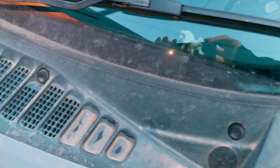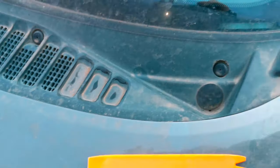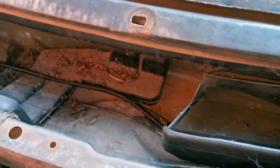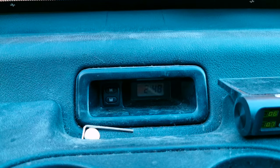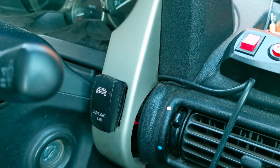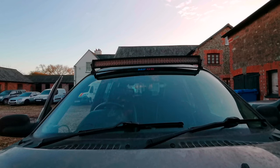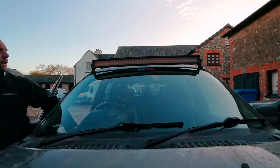For the switch wires, if you lift up the scuttle underneath the windscreen — it's got those horrible little rivet things that tend to break every time you try to take them off — you pop them out, take off the plastic scuttle, and in the middle underneath the windscreen there is actually a grommet that comes out behind the clock in the dash. I fed the wires in through there, over to the right-hand side of my steering wheel, where I then installed my switch.